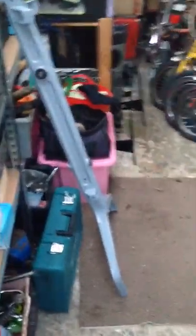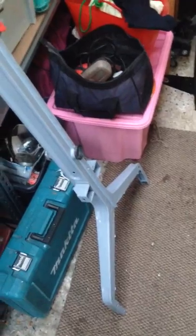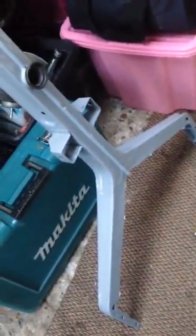And then we've got your chassis, which is looking absolutely lush. Cleaned off all the bearing holders, masked all these parts here off, rubbed it all down using a mixture of the hard coarse angle grinder with a wire brush on it — which is lethal — gets rid of most of the bad stuff, and then just used my mouse sander. It's a combination of wire brushes to get as much as I can. I've taken it down to bare metal in most places. Put on two cans of gray and most of a can of lacquer as well, so it's nice and shiny — should last for absolutely ages.